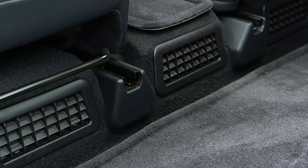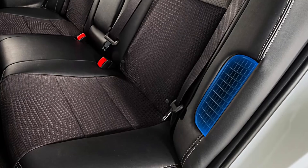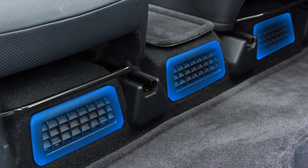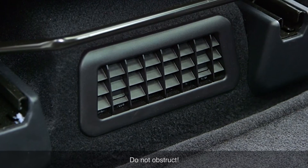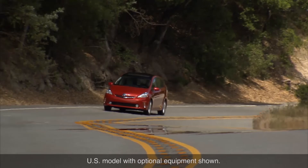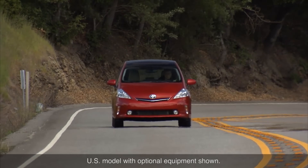Another difference is that there is an air intake vent in one of three locations, depending on the model: on the side of the rear seat, above the rear seat on the parcel shelf, or underneath the second row of seats, to provide cooling air to the hybrid battery pack. It is extremely important that the vent remain unobstructed to prevent the hybrid battery from overheating, which could lead to reduced power output and a shortened lifespan for the hybrid battery.